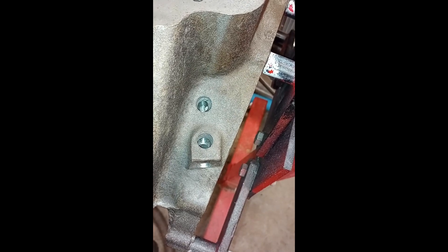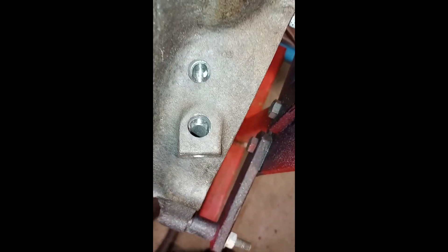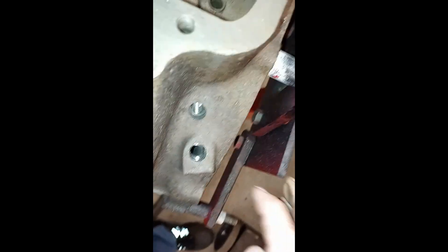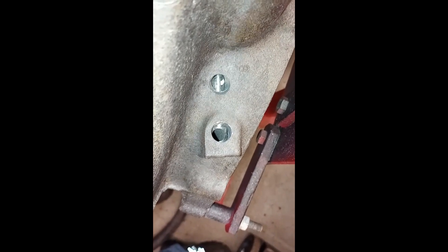This is just a short video showing the modified oiling system on the flathead. This is a hole I drilled — this is nothing new, it's been done a million times. I haven't tapped it yet, but I increased all the sizes inside. There's going to be a plug at that shoulder, so the oil will have to go this way and that way, not across.